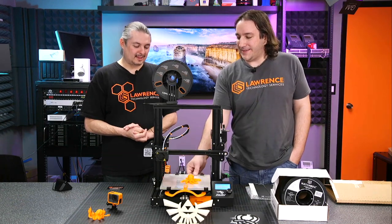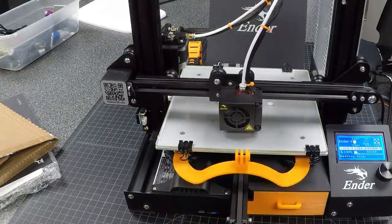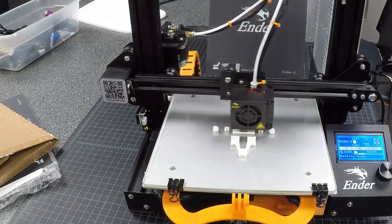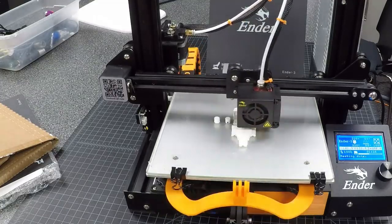It's not really that loud, though it does wake me up when it finishes. When printing is done, the head lifts all the way up, the bed comes all the way forward, and the sound of the screw gear and the bed moving creates a bit of a high-pitched squeal — so I have actually been woken up by a print finishing. We'll leave affiliate links for where to get this and which filaments we used, plus a time-lapse video. After 11 months of use, we've had no breakdowns — nothing has come loose or broken. I've had to clean the nozzle out twice.